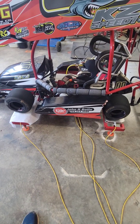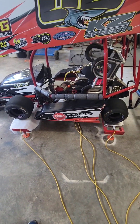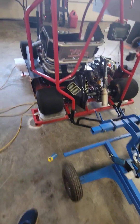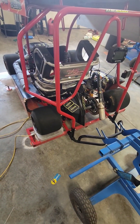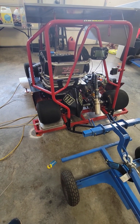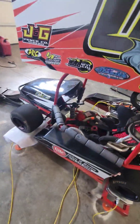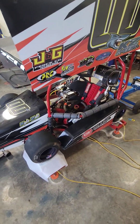Now I'm going to drop the rear on first, then the front. I'll make sure the scales are centered on the tires to the best of my ability. One thing about these electric lifts is when you've got to pivot the go-kart left to right, it doesn't really want to do that. Then I'll check toe and start writing numbers down.